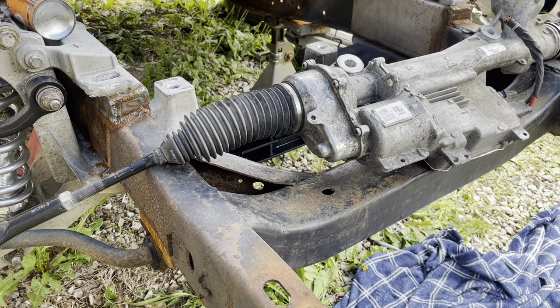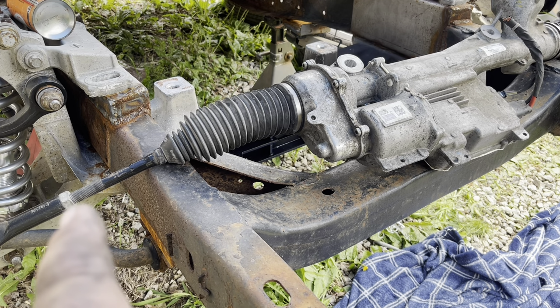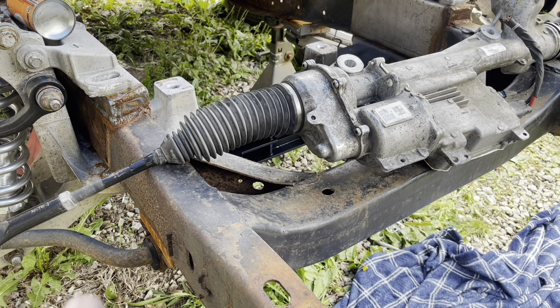Now this rack and pinion at the end over here, right there, you got to take those off. I haven't done it yet. We want to take those off. We got to cut an inch of threads off of there, and it came with new tie rods and everything. I still got them in the shop that are re-drilled and tapped to go back on it that fits the knuckles correctly. Got the new tie rods and ends and everything to go in there. So, all right, well, I'm going to get to it here.